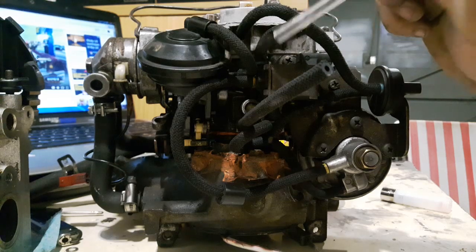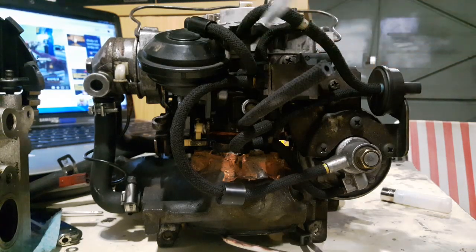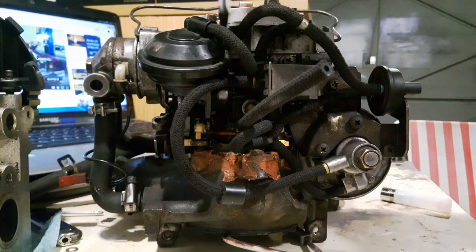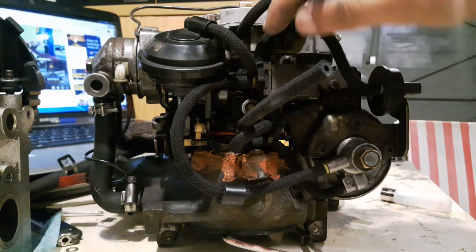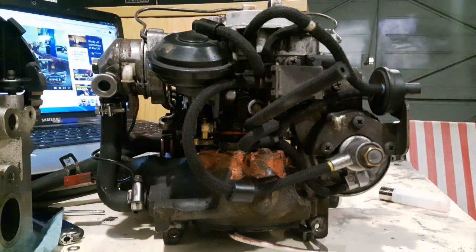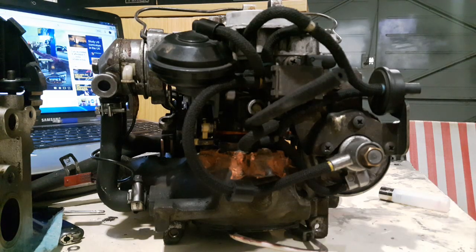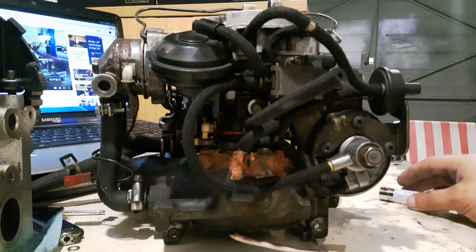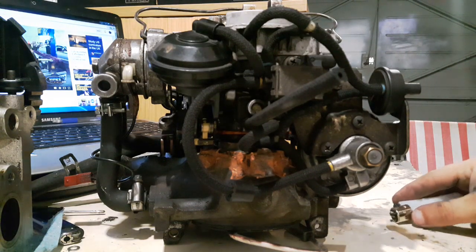Also, you've got your second stage vacuum throttle here. There is a little node at a 45-degree angle behind — just there. And that controls your second stage vacuum-operated throttle butterfly. So hopefully that's alleviated any confusion.